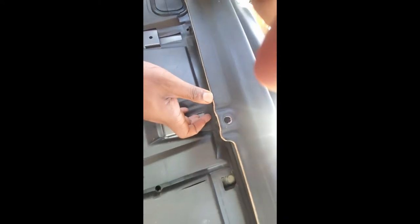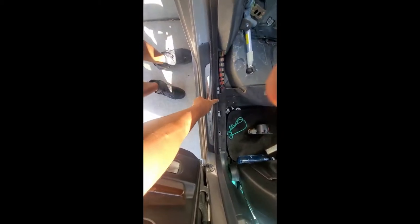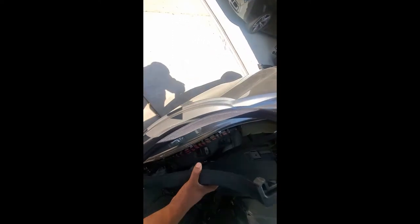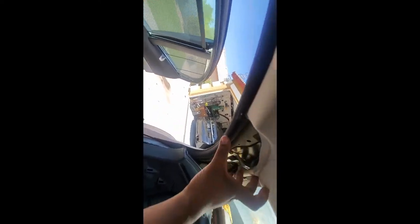There are bolts — you can see the studs underneath. I've got this already pulled out. But before you take that off, you need to remove the inner trim where your door seals are — the lower one and then the upper one. There's one on the floor you remove first, and then come up and remove this one. Also be careful when you pull this off — there is a plug at the top there. Pull it off first and then unplug it. It's easier if you pull the weatherstrip off first and then pull this piece off. Before you pull that piece off, you need to pull the C pillar off.